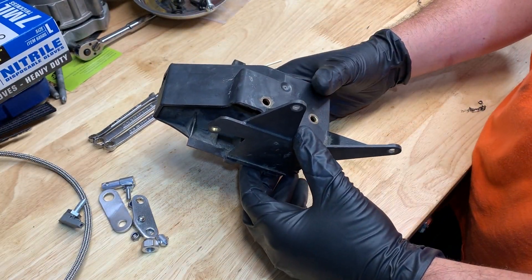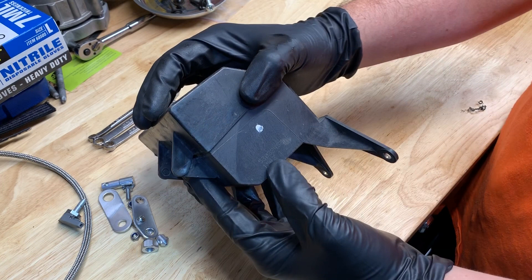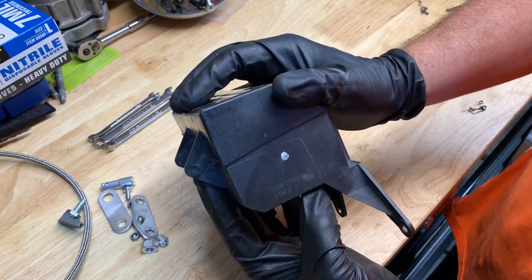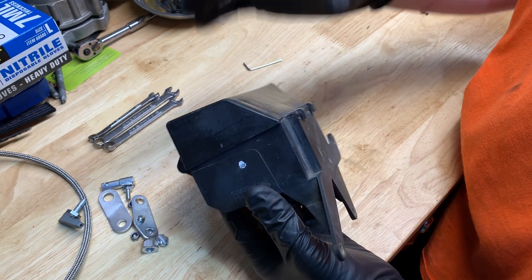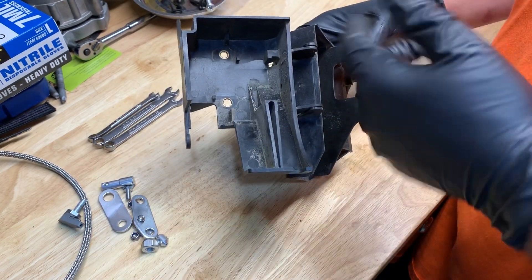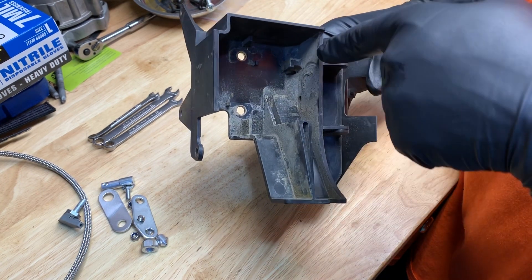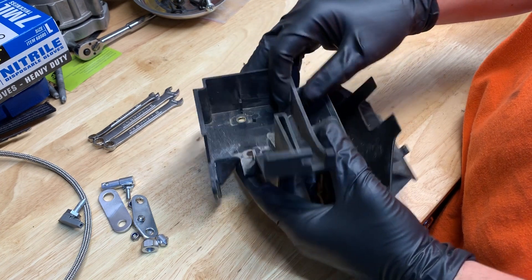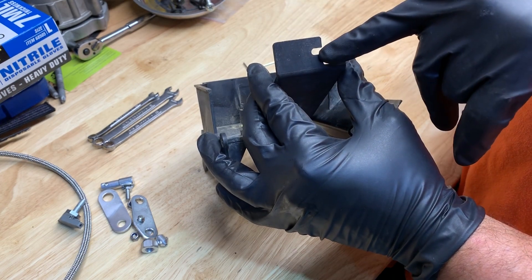So that's what we're going to be talking about — the infamous 2003-2004 bell crank assembly for the Hemi swaps. The part number is 53032456AE. That actually changes a little bit; you may see some different part numbers, as there are subtle differences between 03 and 04. The 2003 and 2004 Ram is where you find this. This is just the casing. Inside you'll see your two inserts where your bolts go through to the actual throttle position sensor, and this area is a detent that holds the tab for the return spring.